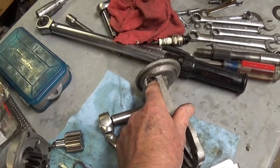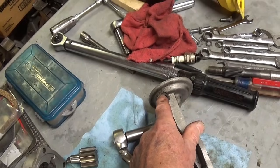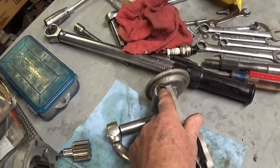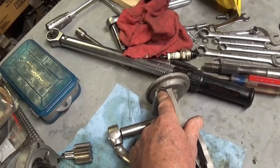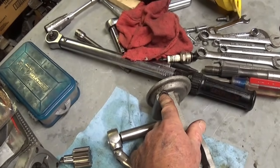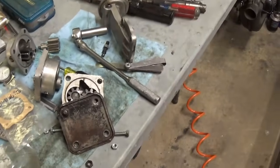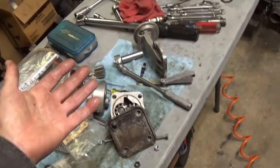The bigger gear creates more pressure. Now this is a relief valve - you have a bypass valve in your filter to keep it from exploding and starving your bearings. It's more important to get oil to the bearings. This is also a bypass valve, so if you've got a power pulley and light flywheel and you're revving the engine, these things are opening and closing. That's why you always want to retain the idiot light no matter what gauges you use.